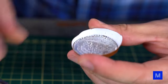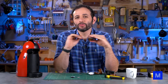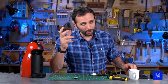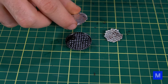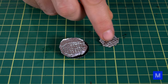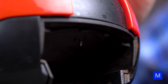Down here there's some kind of filter. What a smart way to isolate the coffee inside so it doesn't have contact with the air and doesn't oxidize, to maintain quality. At the top you have normal plastic that is punctured when you put it in the coffee maker, but at the exit it's smarter — it's aluminum foil sealed over this prickly surface. The moment you apply pressure, the aluminum foil pierces. You can see it's working as a filter, letting water through, and then it loses the seal. Here in the coffee maker we can see the needle that makes the hole in the top of the capsule.